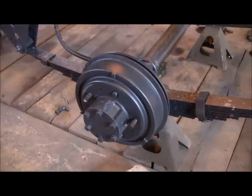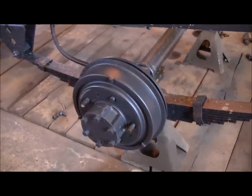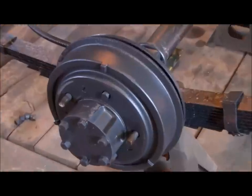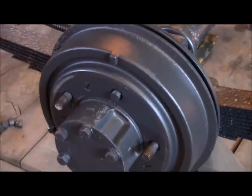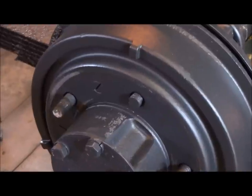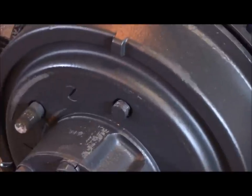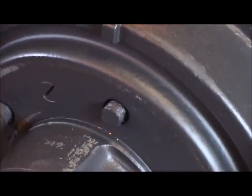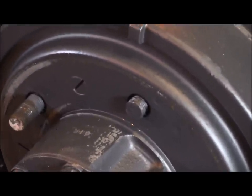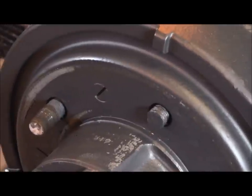With the wheels off we're ready to get to work on the hub, but a couple of issues came up — not actually uncommon. These trailers are the same as the Jeeps of the age: they have left-hand and right-hand threaded lug nuts, and it never seems to fail that somebody doesn't know this. They put enough power on and snapped one of the studs right off, so we're going to have to replace that stud once we get the hub off.